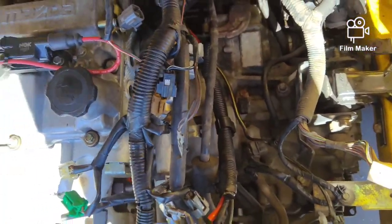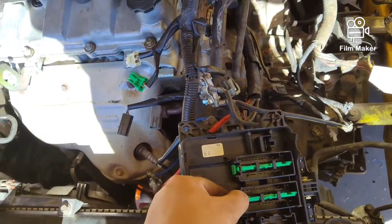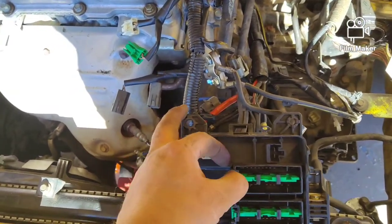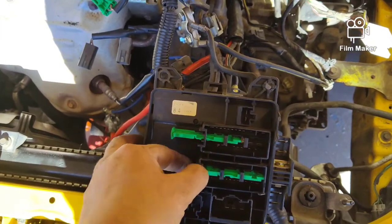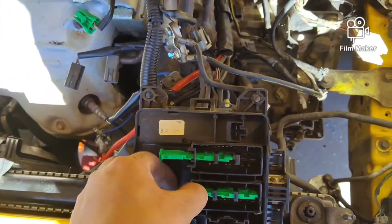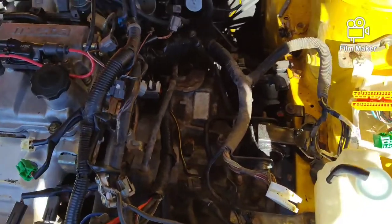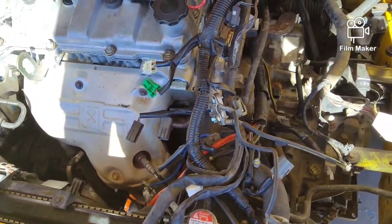If you look at your fuse block and you guys struggle to get these plugs out like I did, no, these don't just unclip. These actually slide out like that. Same, and then it'll disconnect your wiring. Just if you guys are ever pulling the plug wires, they just boom. So little tip for you guys out there. Now we'll go down under the car, and I'm probably going to actually stop for today. This video is going to consist of several days worth of work.